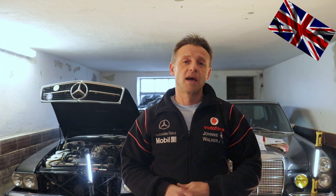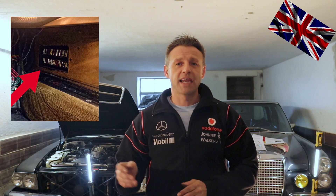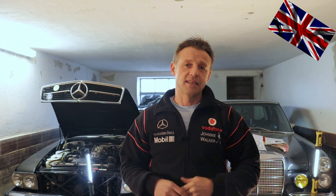Second, another electronic component to check is the over-voltage relay, also located in the footwell on the passenger side — on our 107 models, right above the fuse panel. This small part protects all other electronic components from damage due to over-voltage. It has a tiny built-in 10A fuse, so if you are already there in the footwell, you can check the fuse. If it is damaged, it is easy to replace since it costs just a couple of cents — a nearly effortless and dirt-cheap fix.